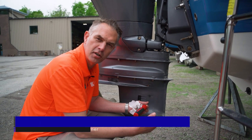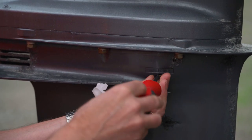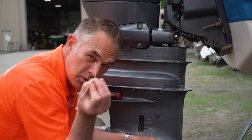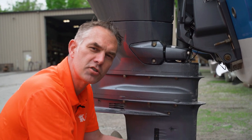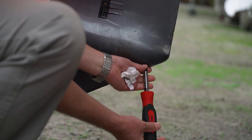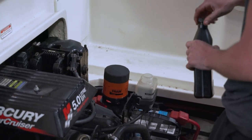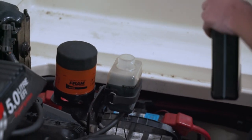While the boat is out of the water, either on stands or on the trailer, you're going to want to check the lower unit lubricant — that's the lubricant that keeps your drive functioning properly. You'll want a nice big screwdriver. First check the level, and if lubricant doesn't come out of the level hole, use a small item, preferably white, to put in there to see that lubricant is at that level. Assuming you changed the lower unit lubricant in the fall, all you have to do is check for moisture by cracking the bottom or fill screw. Pull it out just a bit — if there's any moisture it won't look like lubricant, it will look like chocolate milk. Make sure you clean up after yourself so none of this oil gets in the lake. If your boat is an inboard outboard or stern drive, you may be able to check the lower unit lubricant on the side of the engine via a monitor bottle, and just top it up to the fill line as it may go down over the course of the season.